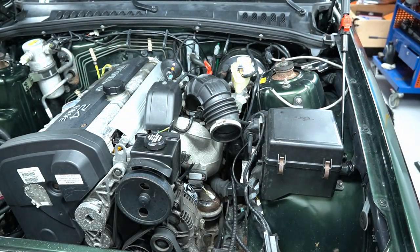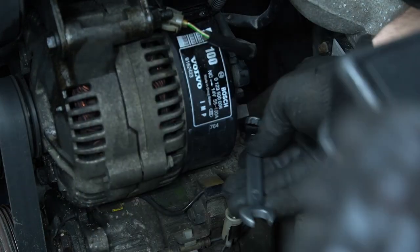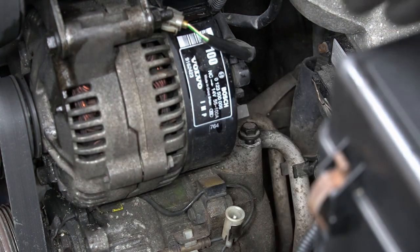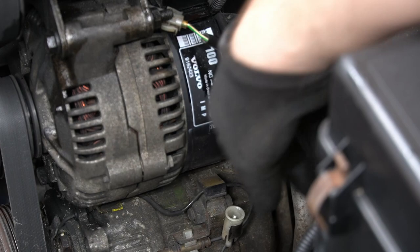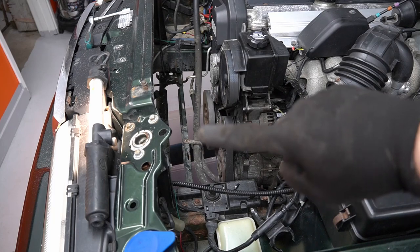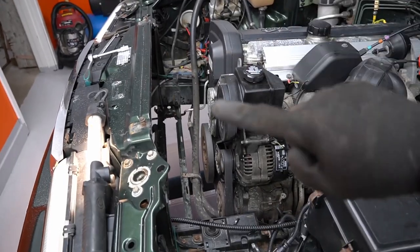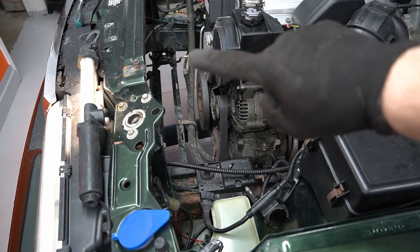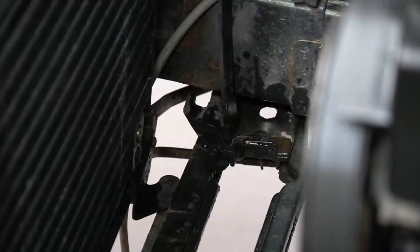Let's get the AC pipes off because they're going to need to go anyway. It's very hard to film here, but we do have a 10 and a 12. Okay, so in order to get these AC lines off, you have one connection here, one connection inside here, and they go along the front member here, or whatever you call it. They run out from the AC pump here and go under here. One goes up top here up to the filter, and another one goes down here, goes under the frame, does a hard turn and goes into the evaporator. Let's go to the other side.